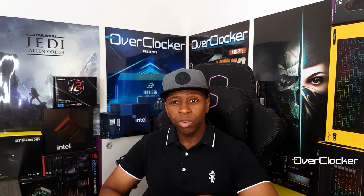What I recorded was about 45 degrees motherboard temperature without any airflow, and that dropped all the way to 32 degrees with just a simple fan on top.